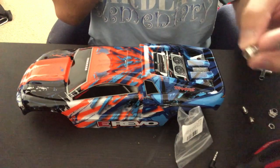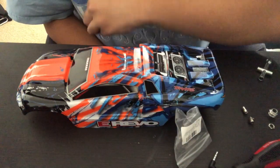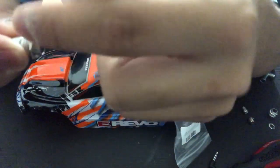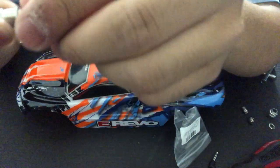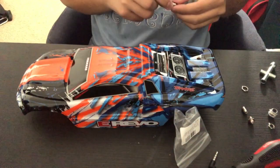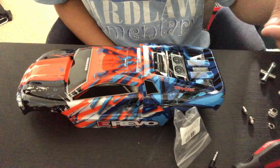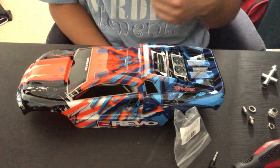Now this one is the easiest way that I can find, where you use these LED holders and you just poke holes onto the front and back, and then you just put these on. These are basically LED housings. You just drill a hole on your Lexan body, and then you take this, this bolt right here unscrews, and then you put the housing on the part where you drilled the hole in, and then if it fits, use this bolt and hook it up onto the other side of the housing. I'm not sure how it works until I actually demonstrate it.